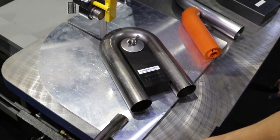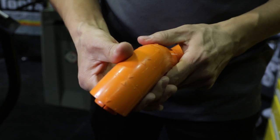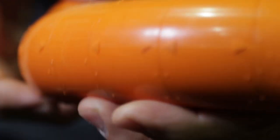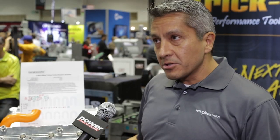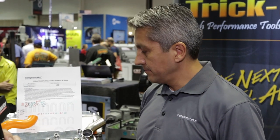Starting with these snap-together pieces — this is step one. What we did is develop blocks that essentially are snappable, just like toys. We gave each one exactly one inch in arc length so you're able to control lengths. With that we're able to create strings of tubular assemblies that take the shape of whatever is needed based on your specific application — to dodge steering rods or brake boosters, or simply find the appropriate length. It's all a matter of counting blocks and snaking them around to mock up the complete exhaust in the real space it's going to live, and come up with a design you can actually build.